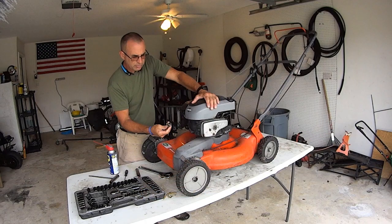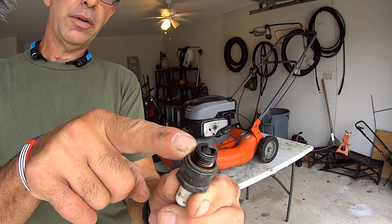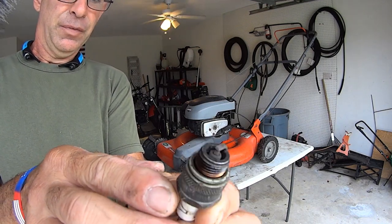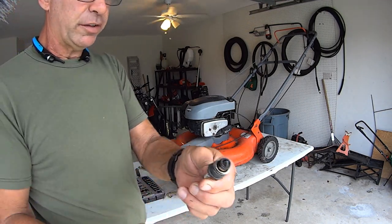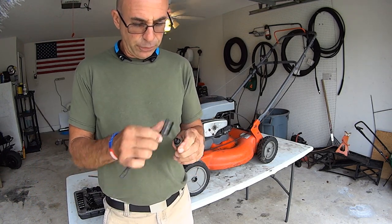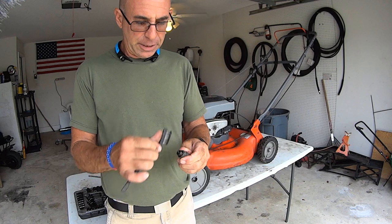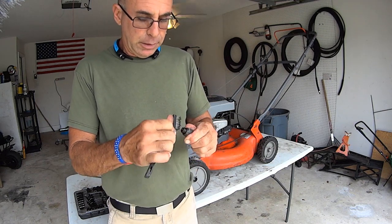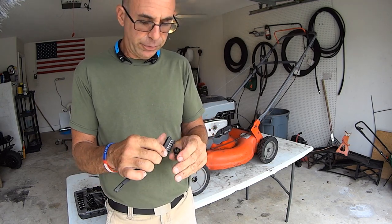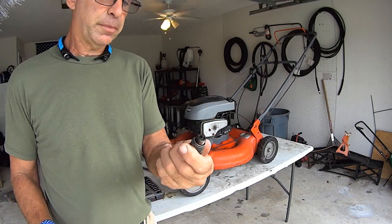Number two, spark. So, look at the spark plug, look at the electrodes. How much gap is there? Is it so worn out? I don't know if this angle works for you guys. But it's not bad. Wire brush. We'll clean this up. See what's up. Good news is this thing's not all nasty black, corroded, or full of crap all over it. We're in pretty good shape. So I don't think we have bad internals on this mower. Simple maintenance, and we might have a mower we can use. Just clean it up kind of nice. That's about it.